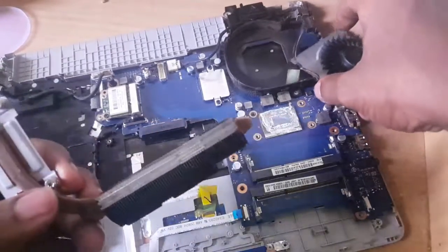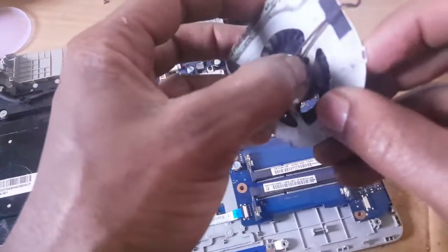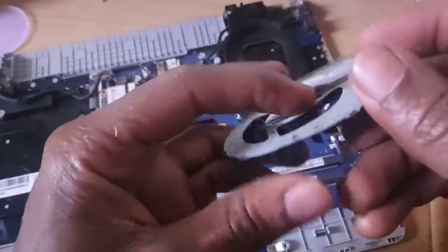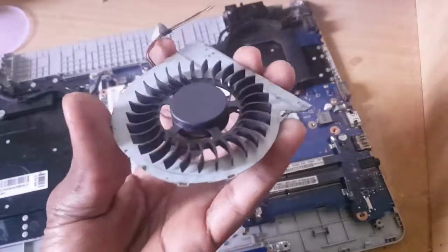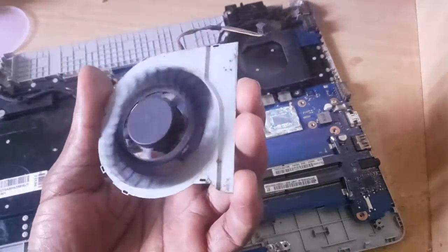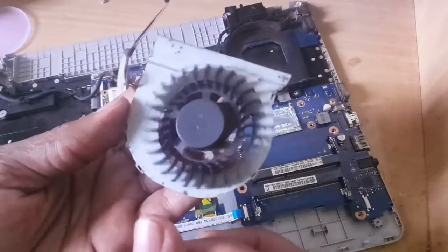To stop the noise, at times you need to slightly open the fan here and put a little bit of oil if it is getting stuck. If your fan doesn't spin — even when you blow it — it means it has a problem causing it to overheat every time. Thanks for watching. If this video was helpful please subscribe, comment, like, and share so that this video can reach very many people.